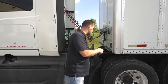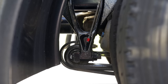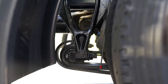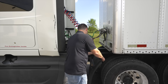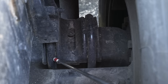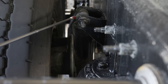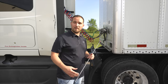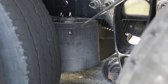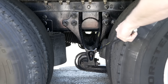Once I'm done with that, I'm going to go into my suspension area before I get to my brake drum. My spring mount is not broken, not cracked, on secure. My spring leafs and control arm are not broken, not cracked, on secure, not scissoring. My U-bolts are not broken, not cracked, on secure. Behind my U-bolts I have my shock absorber — not broken, not cracked, on secure, not leaking. Now we're going to check my airbag. It's not broken, not cracked, on secure, and not leaking. And the spring mount on the rear is not broken, not cracked, on secure.